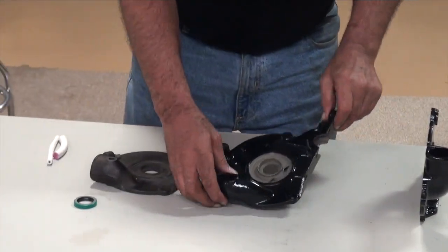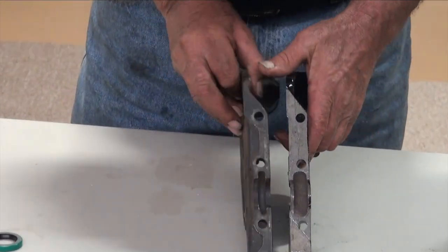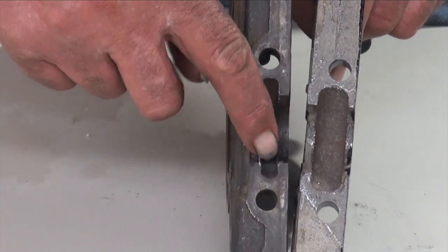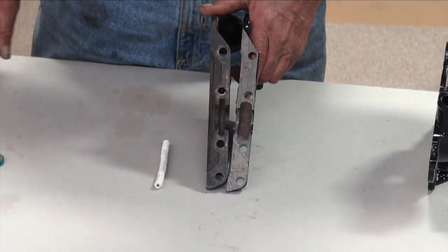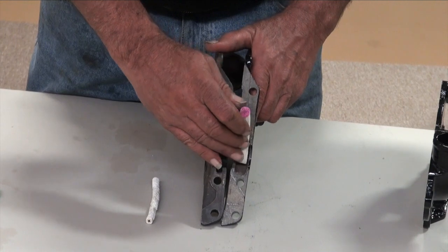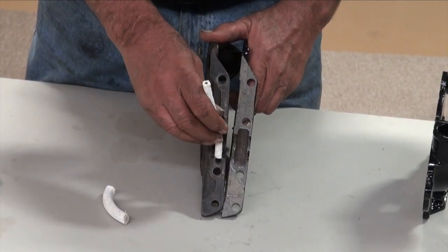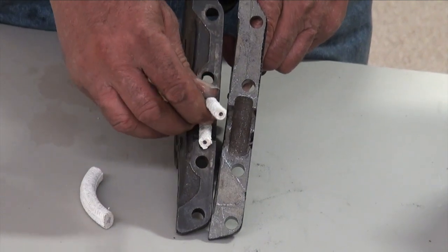We have a couple here — one's been powder coated. There are differences in where you'd bring your seal. In the gasket kits you buy from vendors, they supply you with some felt that goes in there. I like to use a modern rope seal — it's a Teflon-coated rope seal. You can buy it directly from vendors. It's a bigger diameter and would fit inside the larger opening, but for a tighter fit I've got some smaller rope seal that I can drive in there.